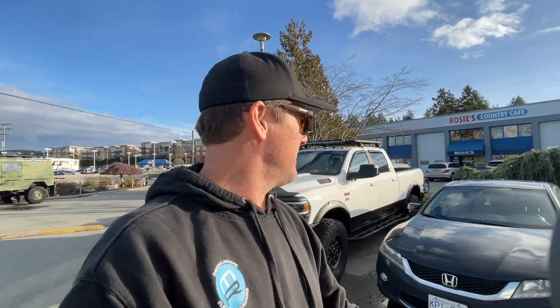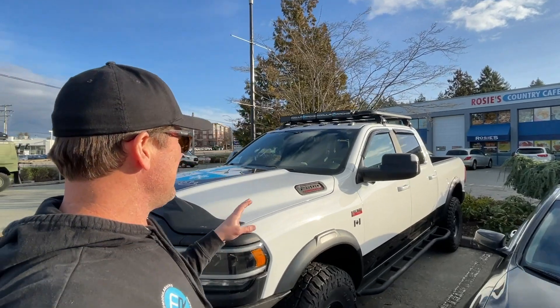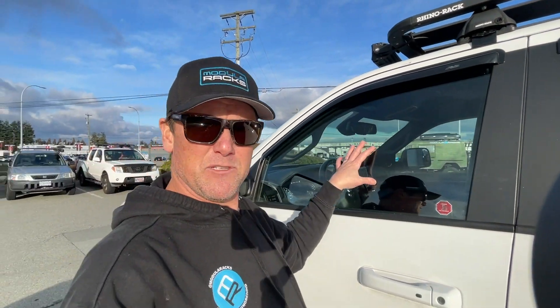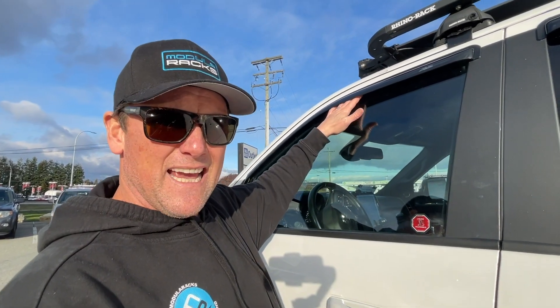Just in case you don't believe me about condensation — I experience this on a regular basis with my Power Wagon here. This truck does not leak. I've had it for three years through storms like you wouldn't believe — bone dry inside — but I don't drive it very often. I've learned that if I do up all of the windows and let it sit, especially in the off season, it will be like a rain forest on the inside of the windows, literally dripping down, soaking wet. Everywhere else in the truck is super dry. That's because glass absorbs heat — it's super warm when I touch it — but it also has no insulation factor, so it cools super quickly. All it takes to prevent this is rain visors, leaving these windows open just a crack — just enough for air circulation.